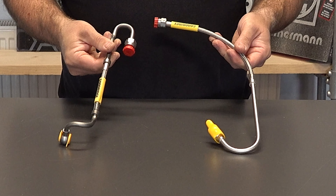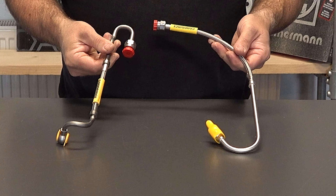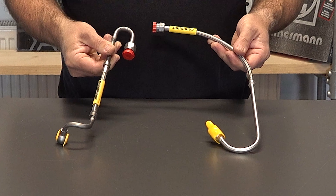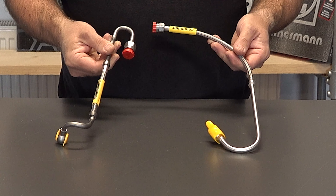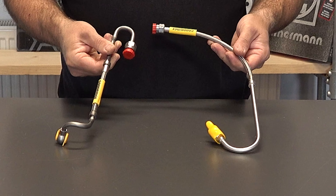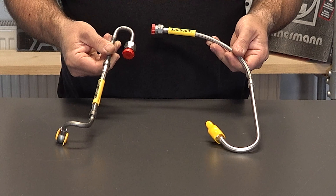These consist of a stainless steel braided hose in place of the original rubber hose, which has proven to collapse causing restriction to fuel flow, resulting in poor running problems. Solid pipework is made from stainless steel and finished with stainless steel banjos and fittings.